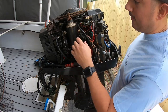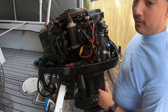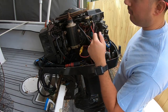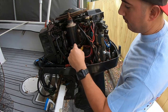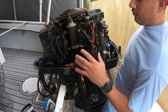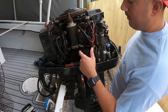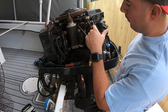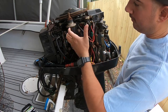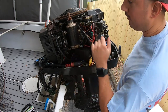That's usually the warning signs before it goes bad. It'll give you two or three times where you'll be able to hit it and get it going, but you don't want to be using a starter like that because it will leave you stranded out there. So first thing we're going to do is turn off the electrical to the outboard, because you're going to have wires coming off your solenoid and your starter that are live, and you don't want to put tools to it where you could ground things out.